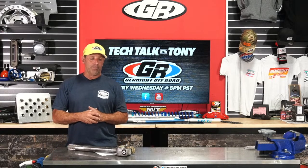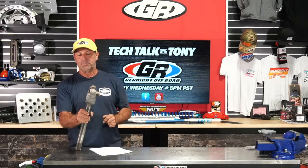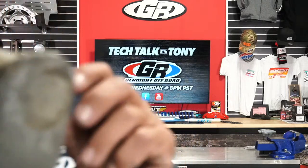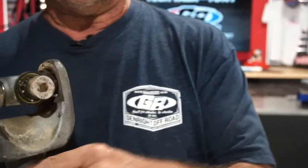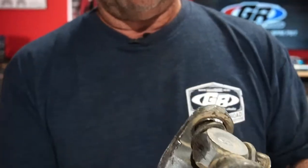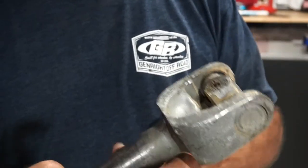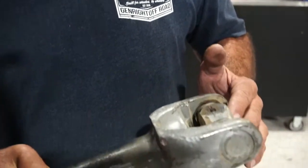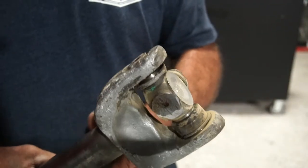I want to start with the obvious sitting here in front of me — I broke a front U-joint this last weekend. You can see it busted the ear right off of it compared to the good side. It totally trashed the side it broke, so we had to cut that off and slide the whole thing out. Fortunately I had a brand new one. I was a little surprised it broke what I'd call so easy — it may have been stressed.